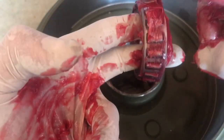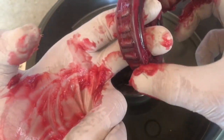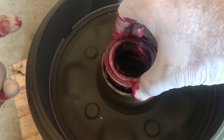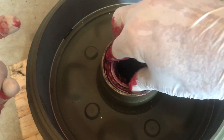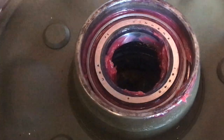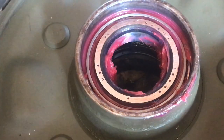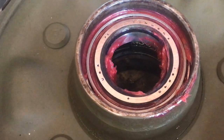The gloves make cleanup really easy, and I'll use a separate set for each bearing set on each wheel. You want to be really clean when installing the bearings. I'll double-check to make sure everything is coated, then drop the tapered side of the bearing into the cup or race inside the wheel hub. Once the bearing is installed, I'll take a clean rag and wipe up any little excess that might be on the hub to prevent the seal from installing properly.